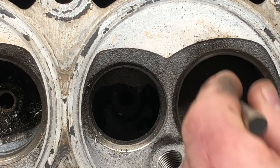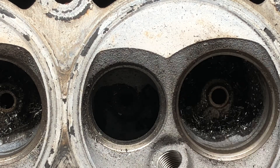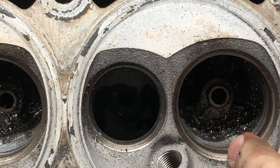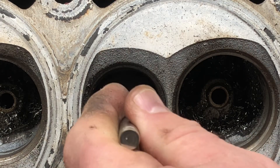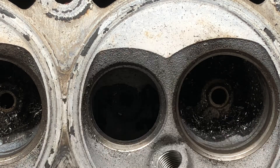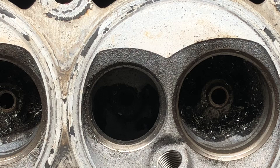This tree is measuring about 615 thousandths on the fattest part - that is the cutting area you're going to use to work that valve seat, half at a time, flipping the head and going back and forth until you get your template to fit through with no resistance. Here's my template - see, no problem. These are going to end up really close to 91 percent on the intake and 87 percent on the exhaust. I got all my bowl cuts done - intake and exhaust - and now I'm going to flip it over and show you the burrs I use and discuss how I use them on the exhaust side.